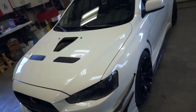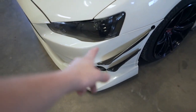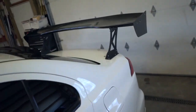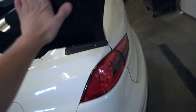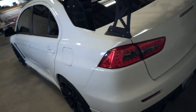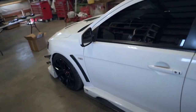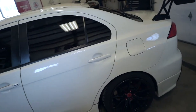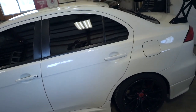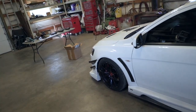What I'm going to do right now — this is not 100% needed, but I think it's always easier to pull a few things off the car. So I'm going to pull these front canards off just so I can buff the bumper like it should be buffed, and I'm going to pull this wing off as well. Other than that, the car shouldn't need anything else removed. I'm going to give the car a quick wash. And typically after that I would clay bar the car, but it was recently clay barred so I'm not going to clay bar this time. If you guys have a very disgusting car, I'd recommend clay barring before jumping into the buff section.